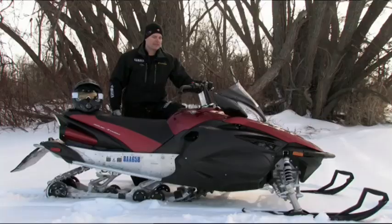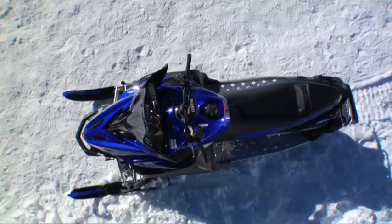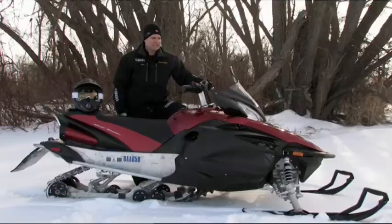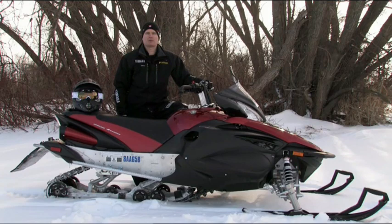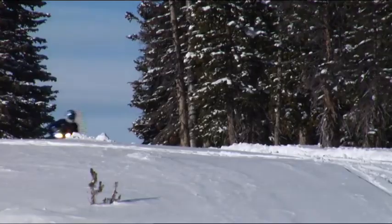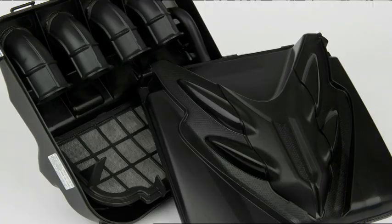And the same goes for the side panels. When you look more closely at the side panels, you'll even see little wings or little fluctuations in the contour to bring that air bubble more around and behind the rider. Even the handle grip warmers have been changed — they're now updated to the new Vector warmers and they've been given more juice throughout the RPM range. We've got more magnetostator output so we can apply more power throughout the rev range; they'll be warmer at almost any RPM. And pay attention to the little details — there are so many tiny little details that really speak about Yamaha. Even the etching in the side panels has a pattern imprinted to prevent scratching that can occur from your knees. We've also spent a lot of time considering the look and the appeal of the airbox.